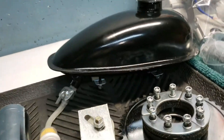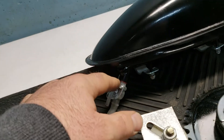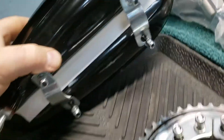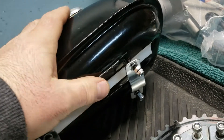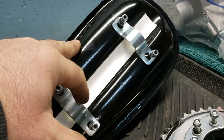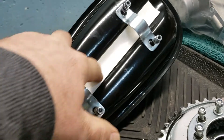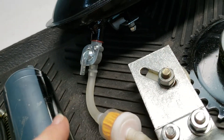The gas tank is fully prepped and ready to be put on the bike. I attach the petcock, use Loctite, and make sure the petcock is perfectly straight. I use foam tape on the bottom of the tank and on the bottom of the mounts, and I give extra hardware so you can double-bolt everything. With the foam or double-sided sticky tape you can mount this to your bike without making the studs so tight they break or crack. I also put the gas line on with zip ties so nothing falls off.